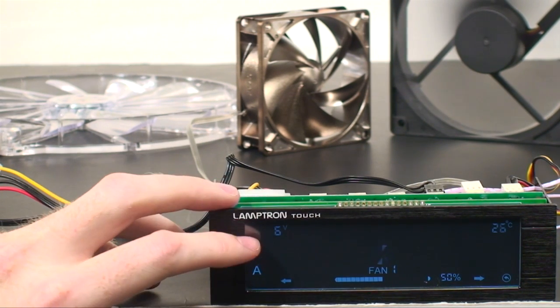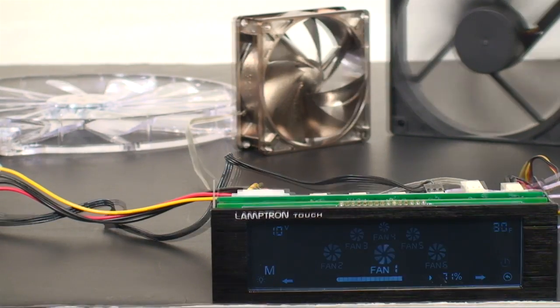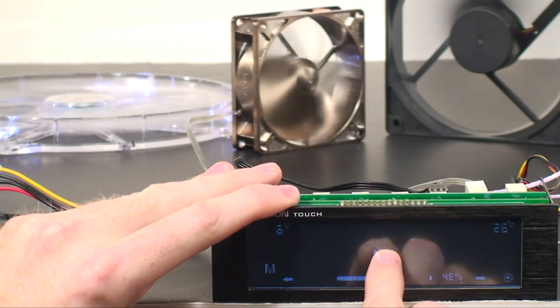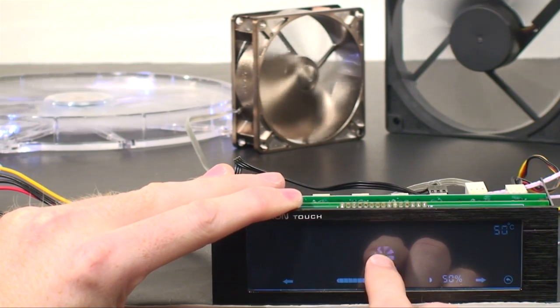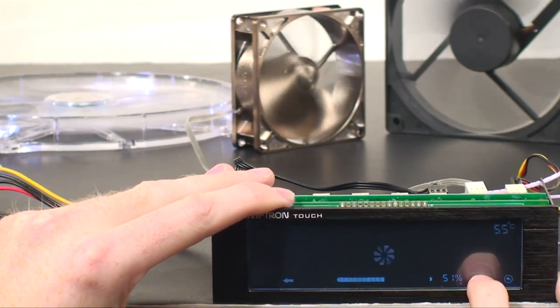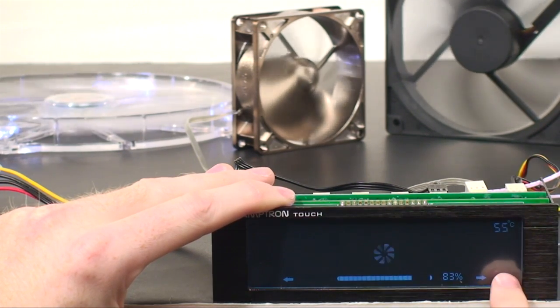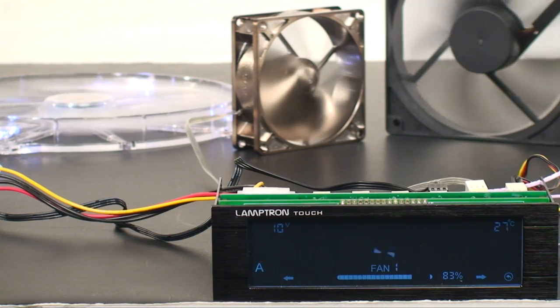Depending on what kind of stats you're looking for, the RPM display can be changed to show volts and the temperature can be switched from Celsius to Fahrenheit. One of the highlights of the Lamptron device that you won't find on more basic units is the automatic control option. For each fan we can individually set profiles based on temperature. When we set a fan to automatic mode, we can go in and set the temperature threshold detected by the corresponding probe, then adjust the fan speed which will act as the default. The fan will operate at its set default speed until the temperature goes over the threshold, after which the fan ramps up to 100% until the temperature drops back down. This lets us control PC temperature without any interference, and because it's done on a fan-by-fan basis, we can set different cooling zones for different areas of the case.